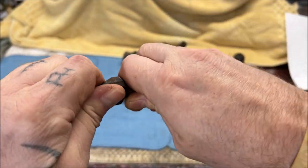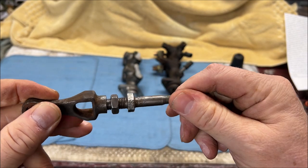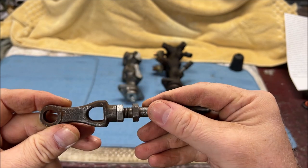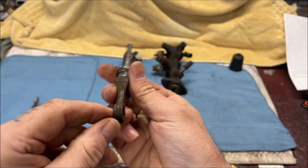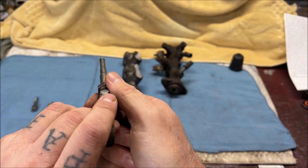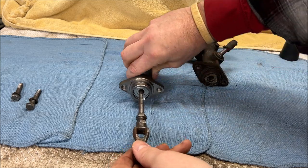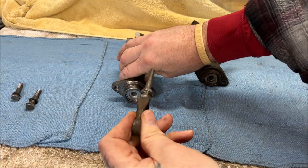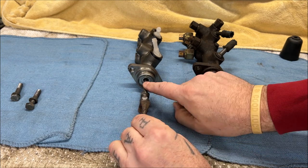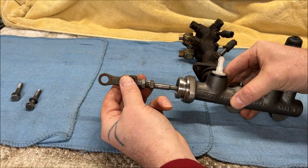There is your lock nut, and then you put a wrench on this and you can adjust it longer or shorter so it moves in or out, then just lock it back off. This goes onto the brake pedal, clips onto the side. So when you push the brake, this pushes the piston inside the master cylinder. This is on the other side of the firewall — it's hooked to your pedal. Every time you push your brake pedal, this is pushing in on the piston, and that's what activates the brakes.